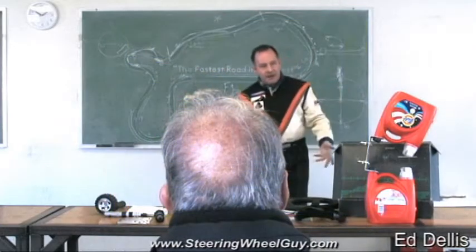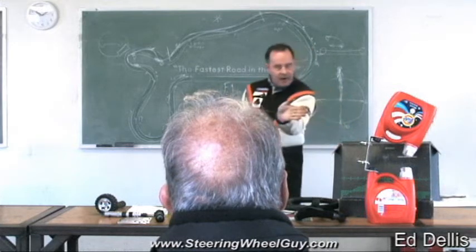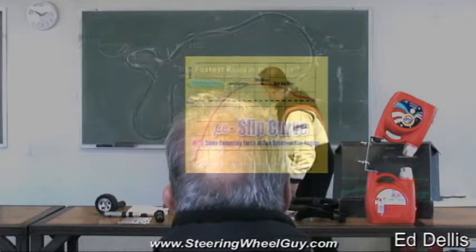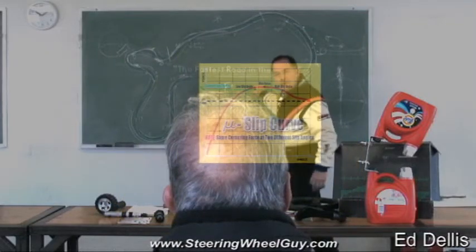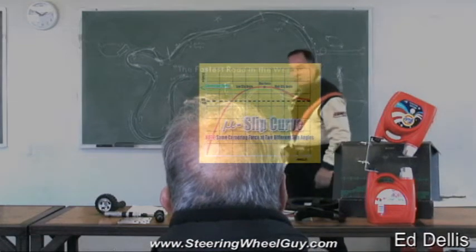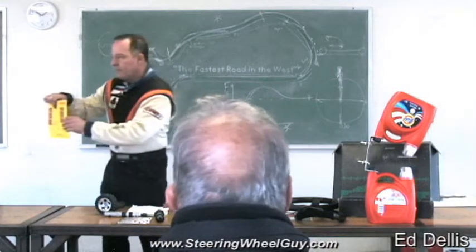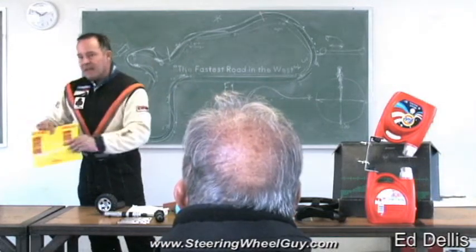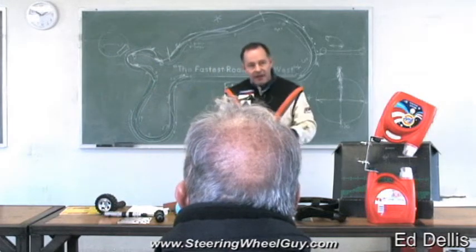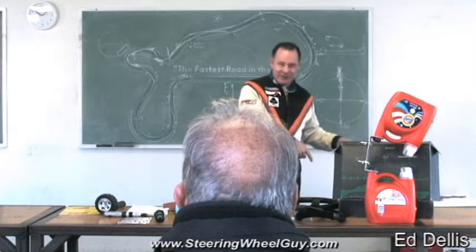Remember, the idea is to go as fast as we can through the corners. So we turn the wheel, and yes, the tire is starting to slip a little. As you start to build up slip angle, the cornering force builds until you get towards the top and it starts to flatten out right here. What you're trying to do is put maximum cornering force for the shortest period of time out on the racetrack so that you can get the car angular towards the finish line faster.